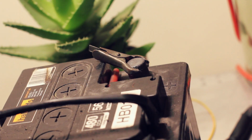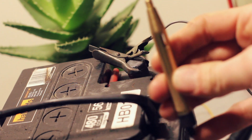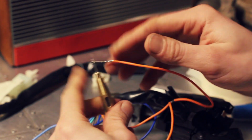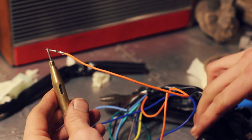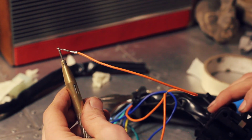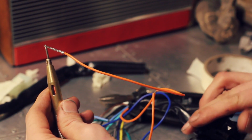On the positive side, let's connect this here, and we have our little reader. And then on this side, let's slot in the orange onto that. So if I'm right in saying so, if I switch the indicator to the right, nothing works. To the left, aha, okay. So I got my ways wrong. So the orange is actually the left indicator, not the right.